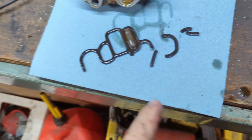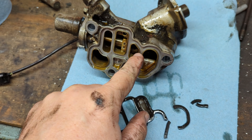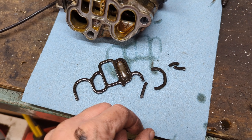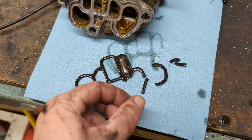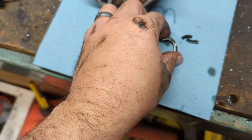I found the culprit. I went ahead and got the tire off and pulled off the oil filter housing — pressure switch housing. There are some valves in there. I'm not really sure everything this does yet. But here is the seal or gasket that goes inside all these grooves, and it is brittle. It was cracked. When I was trying to pry it to see the crack better, it just broke into pieces.